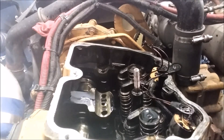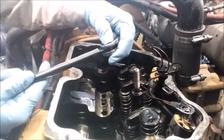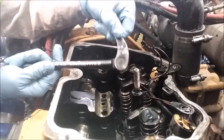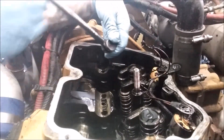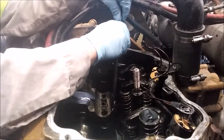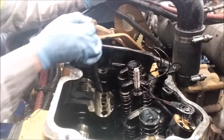You're going to need a pry bar or an indexing heel bar to remove the clamp. An indexing heel bar — Gear Wrench makes them, you can get them from Snap-on, Matco, Mac, whoever. There's a ratchet mechanism so you can move the head of the pry bar to where you want it. They really make pulling these injectors a lot easier. If you don't have one, you can use a normal heel bar — these pop out pretty easy. You just put it under the injector hold-down clamp and pop it up.